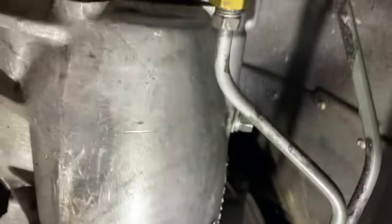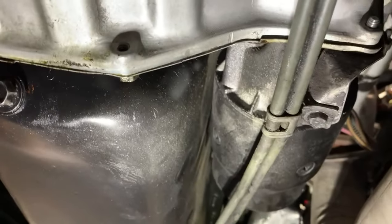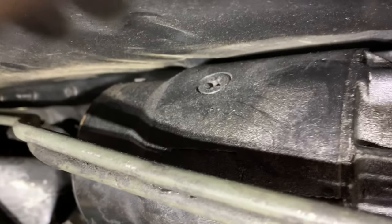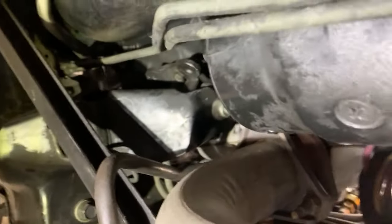Taking a look underneath the vehicle — unfortunately I can't get this vehicle high enough to shoot good footage, so I'll just show you what I'm doing. This is my transmission. You can see there's a leak there that I need to address, and there's also a leak at the bell housing. That should be corrected once I pull the pan off and replace the seal. I'll need to remove the starter in order to remove the pan. Hopefully I can just loosen the brackets enough to move the transmission lines out of the way, otherwise I'll have to remove those lines entirely. And if you're going to remove the starter, make sure you disconnect the battery first because the positive cable goes right to that starter.